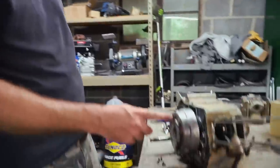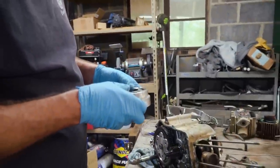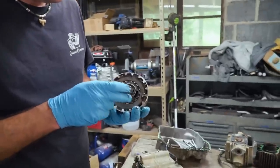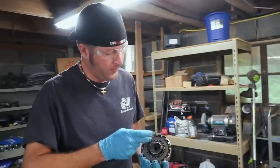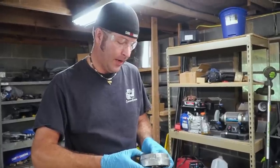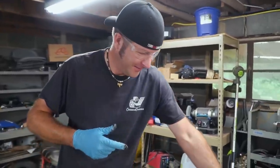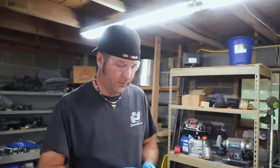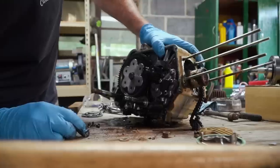We've got these four bolts we can take off too — I wonder if this whole thing comes off as an assembly. This is the clutch. We have supposedly two clutch discs in here. If I were to remove this snap ring and start disassembly, there's actually going to be some rollers that fall out too, and I don't feel like dealing with that. There's a special tool you're supposed to have to remove that nut, but we did it with a punch — a special tool. Look at all that garbage — we're going to have to spray that sucker out.